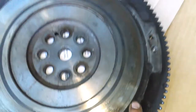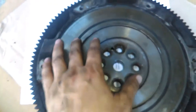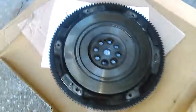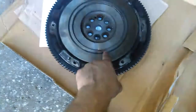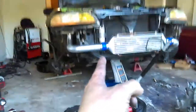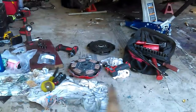Here's the flywheel - it's got this groove like all the way around it. You can see it right there. I went to O'Reilly's to see about getting a new one, which I did. Because it was like 50 bucks to resurface it and 60 dollars for a new one. So I said forget it, I just bought a new one. I got a new flywheel, so this can probably be done today, maybe tomorrow. No more slipping clutch - gonna put that baby right in.